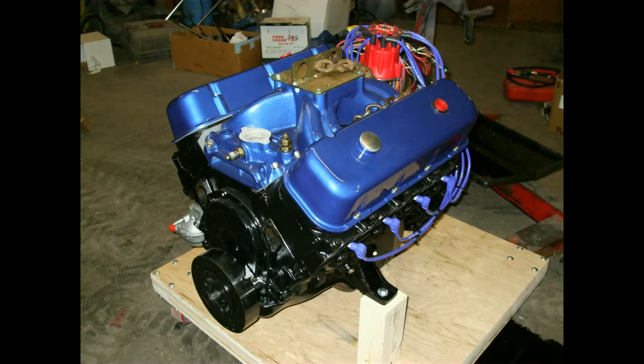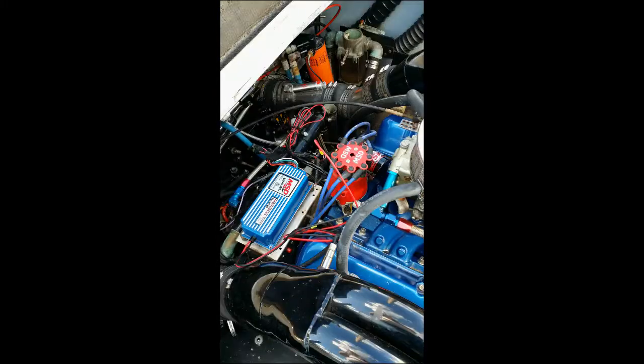I made a cart with wheels to move the engine around while I dressed it to put it in the boat. Another problem with the engine was the ignition — it had a basically automotive-style electronic ignition. It got wet and it quit working. So what I had to do is basically go to a full sealed MSD system.